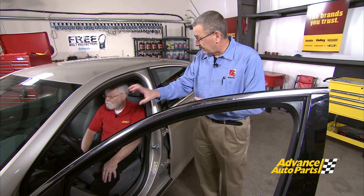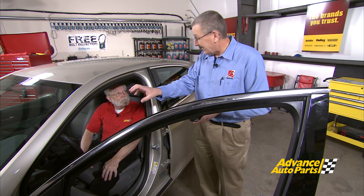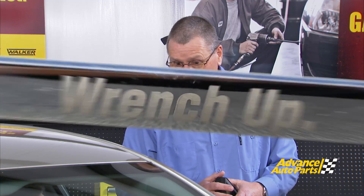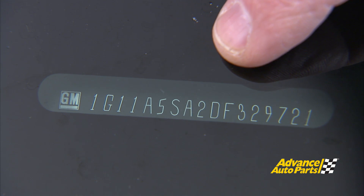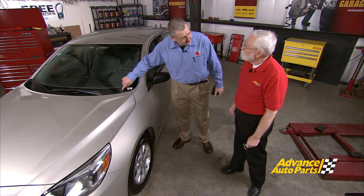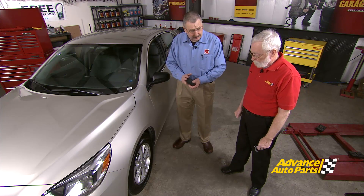That's great information, but we don't know if this vehicle has ever been taken to a shop, had the tires rotated, and whether that position is actually correct. Our tool will verify those pressures as we go around and determine if that is exactly the tire that's low or if it's a different tire that was never relearned after rotation. We need to determine what year the vehicle is, and we recommend getting it off the VIN number using the tenth digit. This is a D, which tells me it's a 2013 Chevrolet Malibu, so I can set my tool up accordingly.